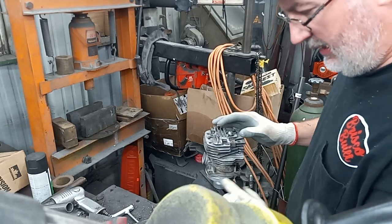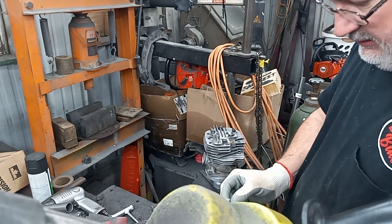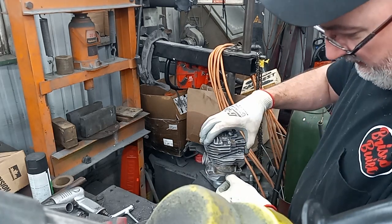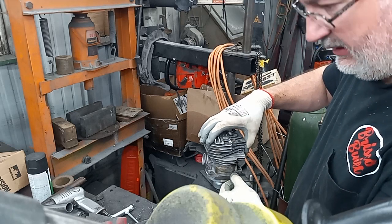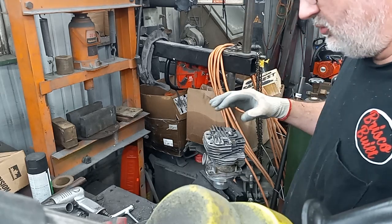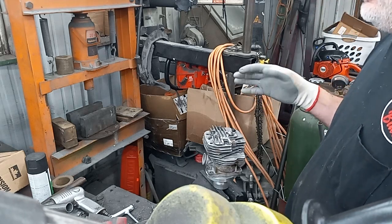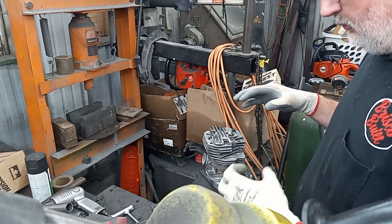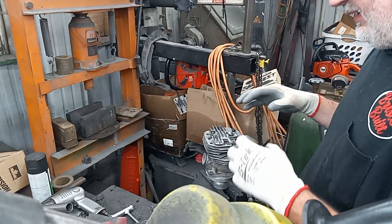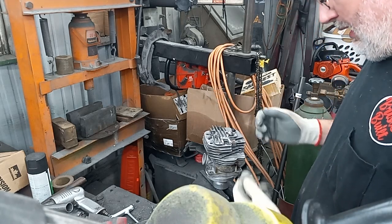And then to set the depth, I use 2 razor blades. I'll just put them in here like that, and then I'll set the depth that I want. 2 razor blades normally work good, and if there is a bad finish afterwards, it leaves you about 5 thousandths that you can use some 120 grit sandpaper on an old piston to kind of clean it up a little bit.